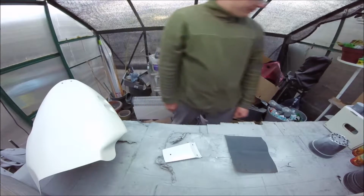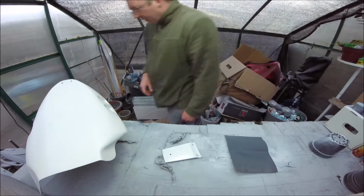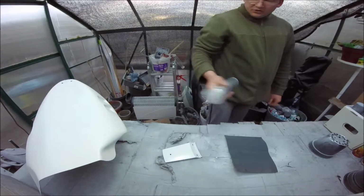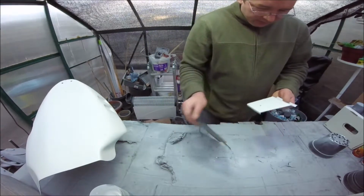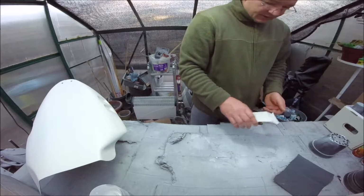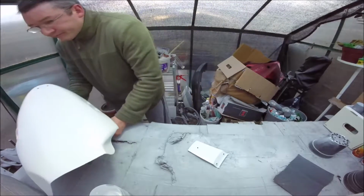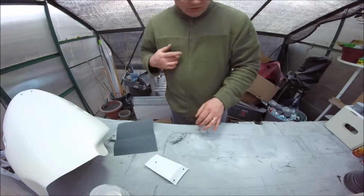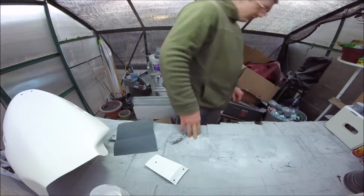I've been doing some research and I've found out where I've been going wrong. You can't let the paint completely go hard and dry. If you let it go completely hard, the base coat, as in this case it's white, you have to key it again before you put the clear coat on, just rough it up a little bit. But it's like primer, let it dry, because primer's porous, so you don't have to rough that up, it's rough anyway. Then put your base coats on, 3 base coats, 10 minutes between each coat, and then you put your clear on 10 minutes after that. You don't have to wait until it's completely dry, cured even. Just leave it 10, 15, 20 minutes and then put the clear on.